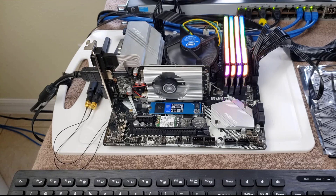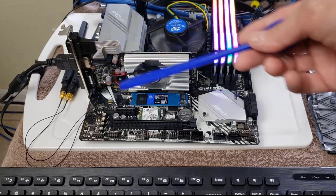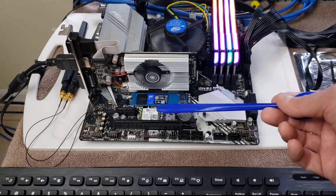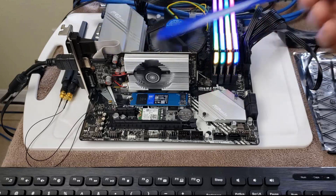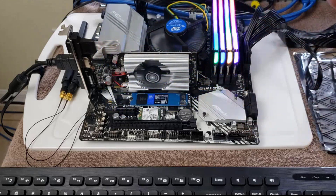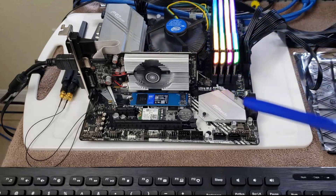When I taught students and when I work on hardware myself, I like to begin with a technique of putting my motherboard and building my PC on a desktop surface. I have a power supply over here in the corner and a surface to build on — I add the RAM, video card, whatever I'm going to do for that particular hardware. I build on an open desktop because it allows me easy troubleshooting and building. I can see everything and work very easily on all the connectors, jacks, and plugs, and it makes it very easy to get it up and running, tested, and verified before I put it into a case.